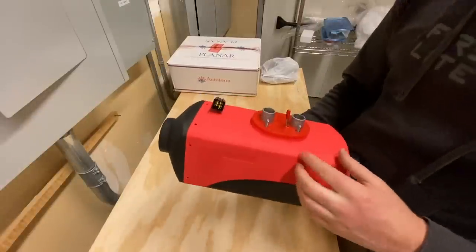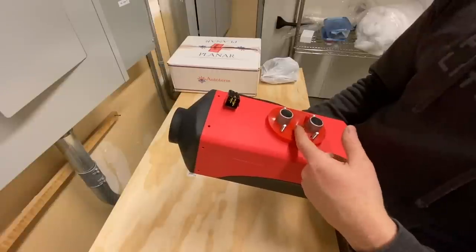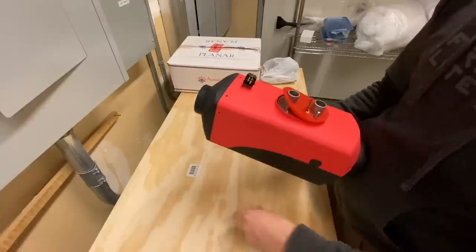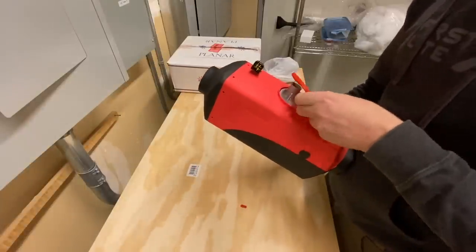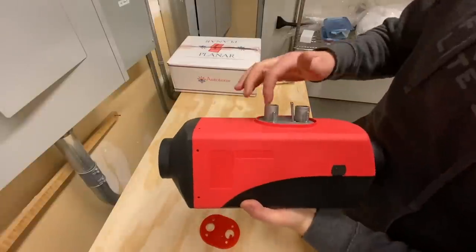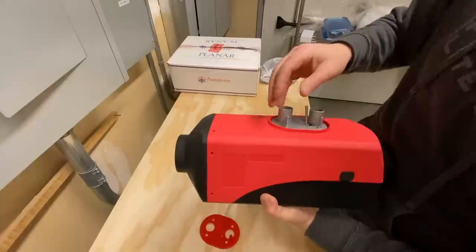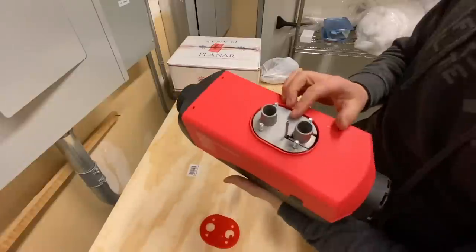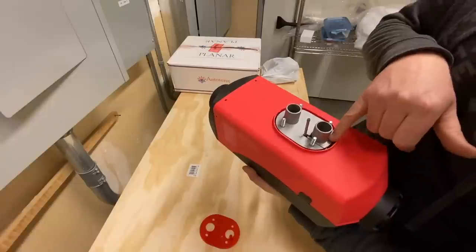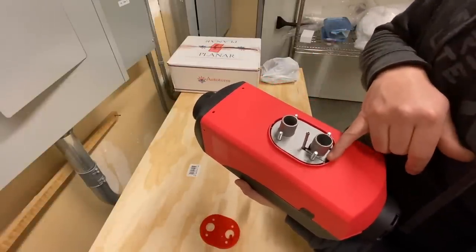Okay, first up I found this fuel line is sitting that way, and it's pushing against this rubber thing, and this rubber thing is not quite the right size in how they cut it, so it doesn't fit really nicely. The other thing is that this aluminum part is actually inset from the plastic housing, which means that these bolts are going to be really tight to be able to suck all that in. And then the other thing is that the intake side of this casting isn't flush with the top of it, so there's a bit of a gap. There's a gap all the way around, but I'll show you why that's there. It's the same thing in the other one, but it's a lot better.